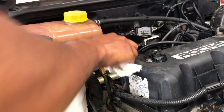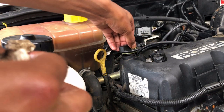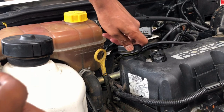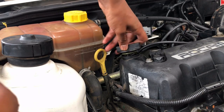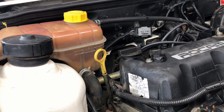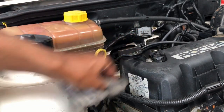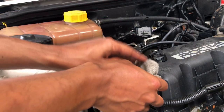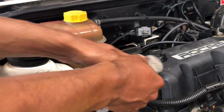Just to make everything clean before we're done — clean up your tappet cover and your oil cap. Please take the car for a test drive just to get the oil circulated and warm. Once you're done, check the level once again — if it needs a top up, do so. If it's between the minimum and maximum, that's perfectly fine. Clean up any residual oil and debris, and there we go — that's the job done!